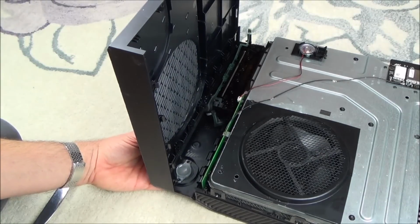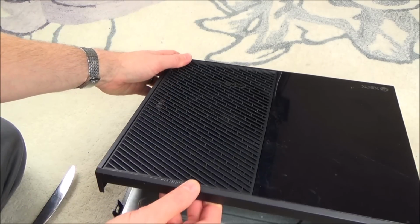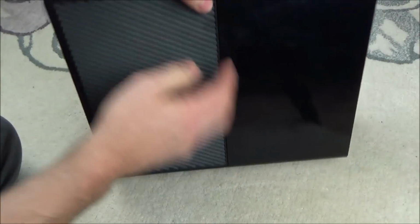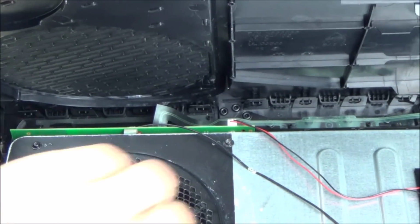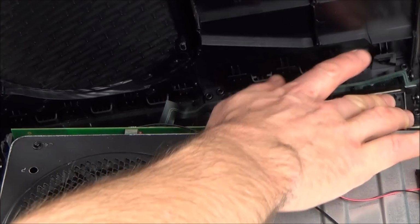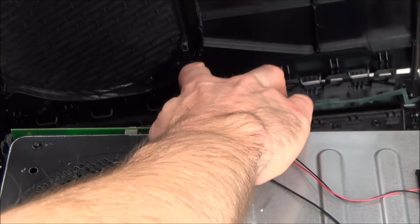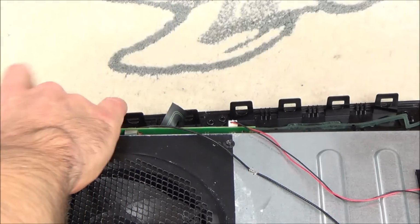But if the front bit stays on for you, so basically if it's kind of wedged on like this, then what you can do is you can either try to just move it up very, very gently until the front corner seal here breaks, because this is joined together with all these clips here. Or what you can try to do is, there's also clips at the front here, and you can reach in and you can start to undo them like that. The problem is they keep wanting to spring back all the time, but once you get the end one undone, then if you put pressure on it there, you can see it's going, and that one, and that one. Oops, that one broke, and there we go, and that one there.